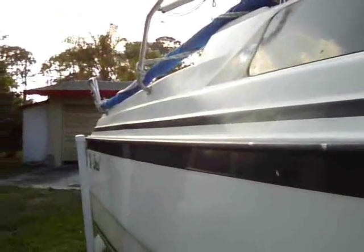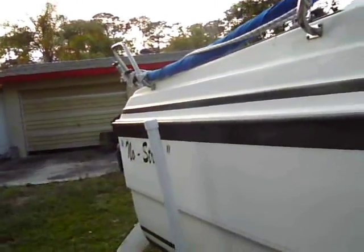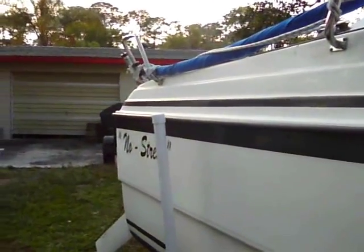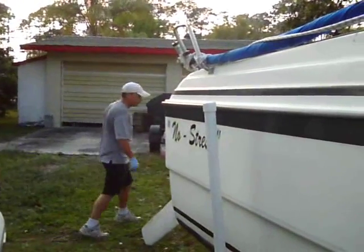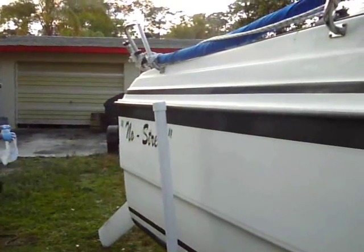Pretty good. It's going to take about 4 tubes. Yeah, you put a lot of 5200 in there. Want to try to keep it clean on there. You don't want that excess to be on there. It gets harder to clean off. Lacquer thinner helps to cut that off.